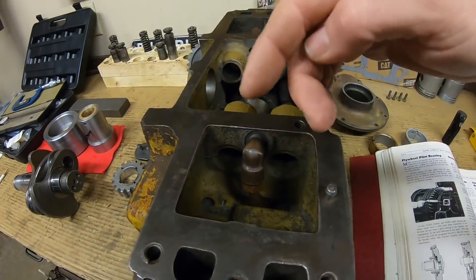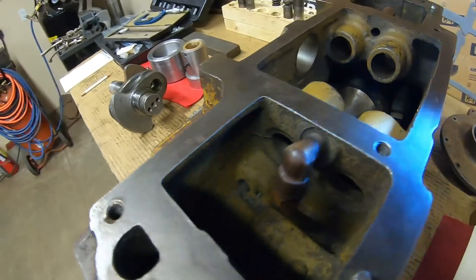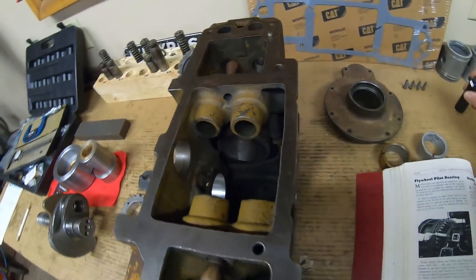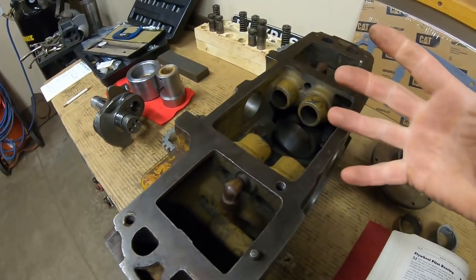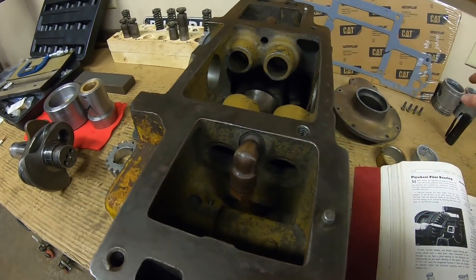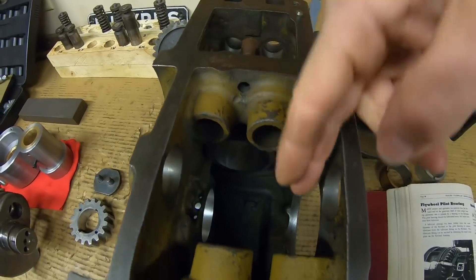Personally I can't back this up with anything, but I believe these tubes are more like a straw — they're a suction device because they go down to the low point of the system. Even though we have this drain hole right here that is hooked to that tube, and a similar drain hole down in that corner that's hooked to the tube that goes to the crankcase — when this thing is running and the pressures are all wonky, I believe those two low-point drains are for after you shut it off, to help all the compartments return down to the sump. I believe these tubes are more for when the engine is running: pressures are pulsing like crazy and this draws from the other low point in each valve cavity to help put oil up into the tappet bores, and I would bet these are probably the returns where the excess comes out and just returns back down to the sump.